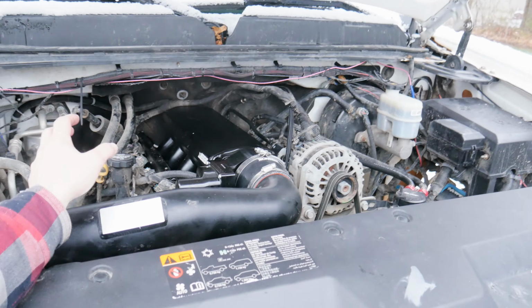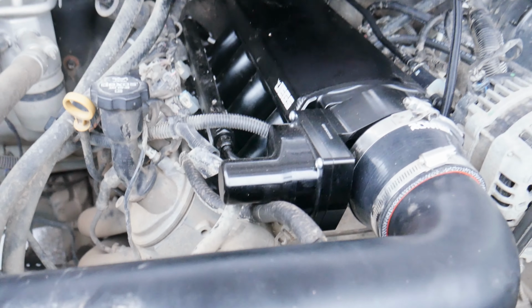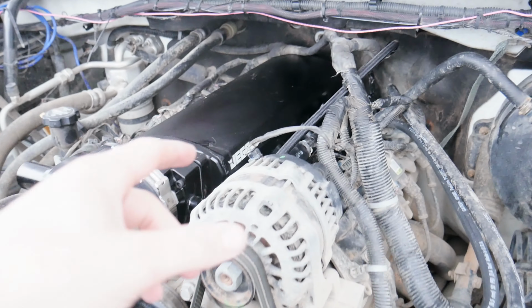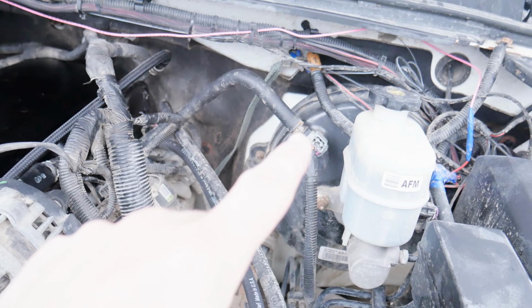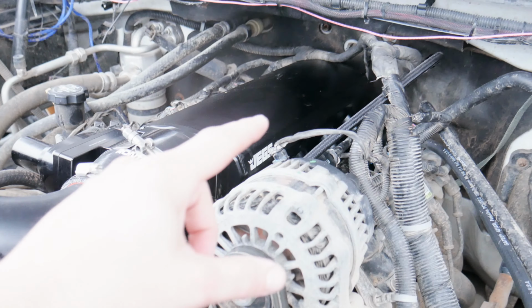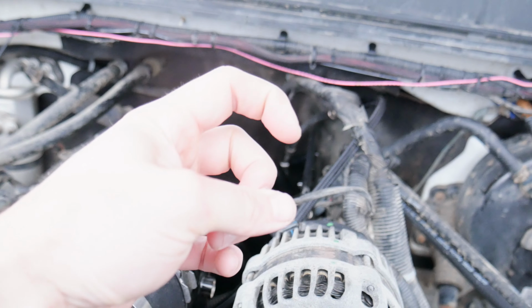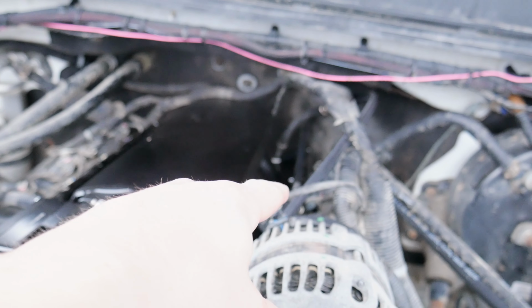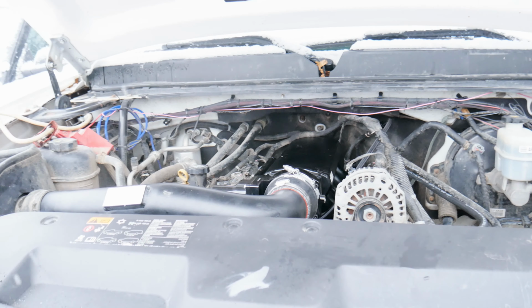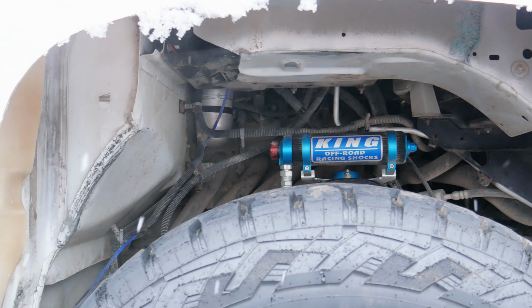Tried showing you this last night, but it was pretty dark. But basically got everything fit up, everything plugged in. This morning, I actually had to fix some problems because I wasn't getting brake boost pressure or brake vacuum pressure, so I actually had to move that clip because I didn't have it on, so I think it was leaking out of there. So that's tight, brake pressure's back. The third injector on the driver's side, one of the prongs actually got bent, so the plug wasn't seating in there. Got that bent back, fixed, plugged on, so everything's good, plumbed. So yeah, we're gonna get this charged back up and go take it for a rip.